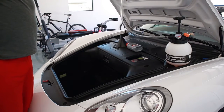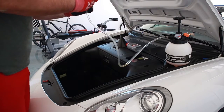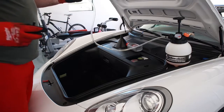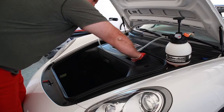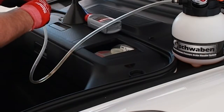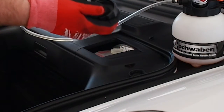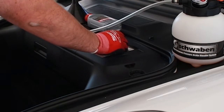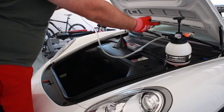Another feature of this particular unit is you have your quick disconnect here. The learning I had, which is a little bit why I'm disappointed in the coverage being lost, I had a disaster because what I did is I failed to secure this tightly enough on there. So you really want to get this cap, and there's a nice thick gasket in there. You want that fully seated on there in order that you don't have leakage as you introduce pressure to the system through this pressure bleeder.